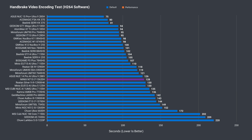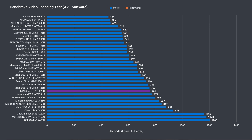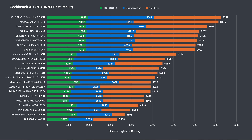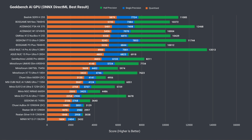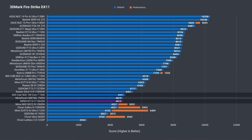This mini does a bit better in the short H.264 CPU video encoding benchmark, but worse in the longer AV1 test. Geekbench AI CPU shows a below-average performer. Doing the same benchmark on the integrated graphics comes back with the worst result — the integrated graphics is also unimpressive in today's market, falling behind even Intel's own 150U CPU.